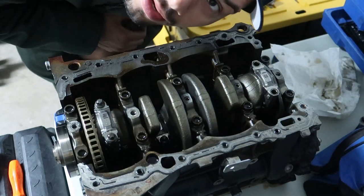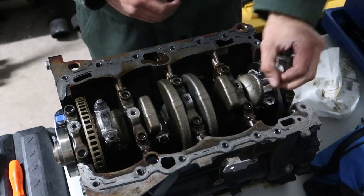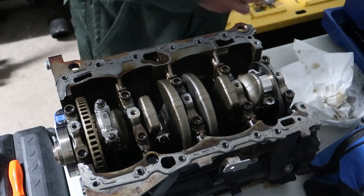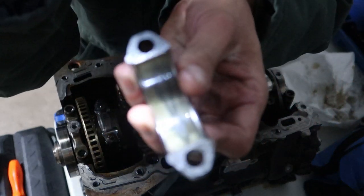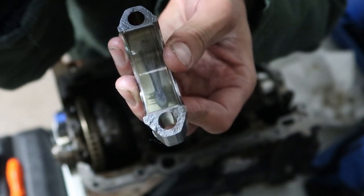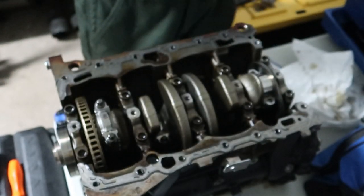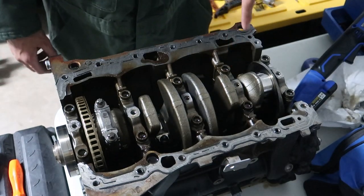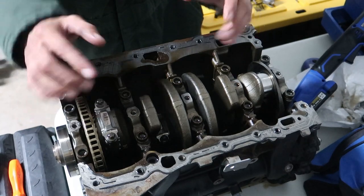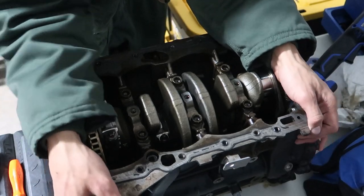Just a reminder - I'm not a professional, I've never done this before, so taking this cap off I've only seen it done on YouTube. That's what the bearing looks like. I gave it a little push and it just fell all the way down. I still got the three other caps to take off, but I'm gonna lay the motor on its side so I can zoom these off real quick and then pop them out. No sensors over here on this side.